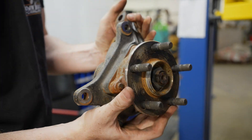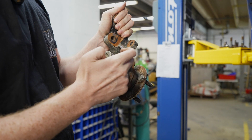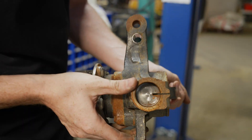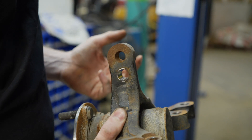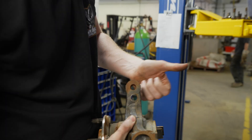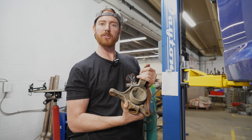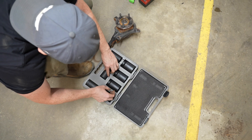There it is — little baby knuckle. Since it's all-wheel drive they have the end of the axle just tightened in so the bearing doesn't fall apart. You can see where they had drilled the tie rod — it didn't get a ton of angle but it was kind of limited by the control arm anyway. If they had put it further over, his Ackermann would have been better. We're going to scan this and build the geometry that we should have for this car into a new knuckle.